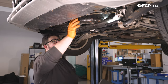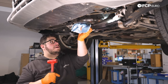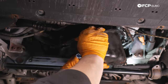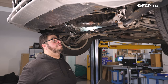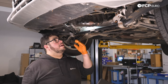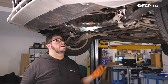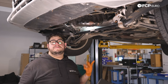Now we're going to grab a rubber mallet, give this pan a little bit of a hit and it should break it free. We have a catch pan situated below — I'm just going to stick a finger in here and kind of grab onto it. At this point the pan is bottoming out between the subframe and the housing inside for the oil pickup and oil pump. So we tried it without raising the block. Most people are not going to have tools at home to support the block or lift it, but if you do just make sure you have it handy. Now we're going to set up the bridge across the fenders, raise up the engine a little bit, and that'll give us enough room to weasel this pan out.